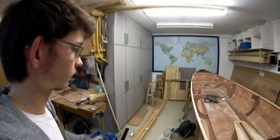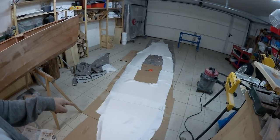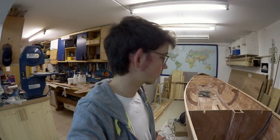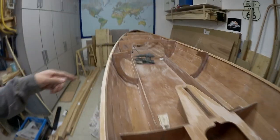One eternity later — that's what brown hair looks like after three hours of sanding. But everything is sanded, every surface in the boat. I'm running a little bit out of time, so what I'm going to do today is epoxying the fiberglass to the deck panel, and maybe clean everything up because it's just dusty as hell. Tomorrow is Sunday so I cannot make too much noise, so I am going to fill in all the gaps with thickened epoxy tomorrow.